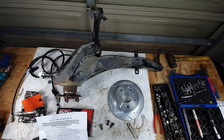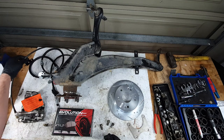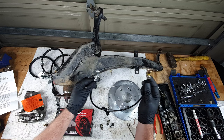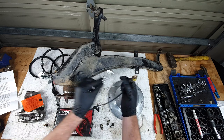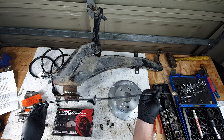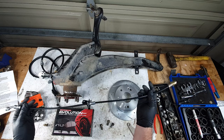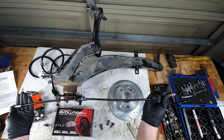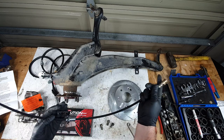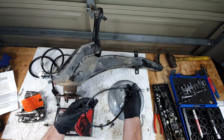So first thing you're gonna need is a longer brake line, sorry, which is this. This is to suit the Prelude rear disc and go to the chassis. If you're in the States, apparently there is a person over there that sorts it out for you, and they need to be 32 inch long brake lines. I've gone a different route, and I had a friend, Lawrence, at Nelson Brake and Mechanical and Brake down in Tahuna. He sorted me out this cable.